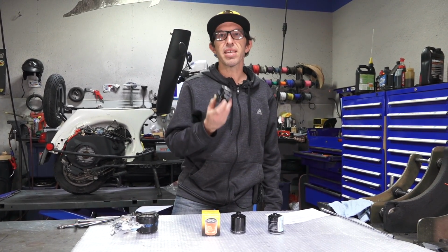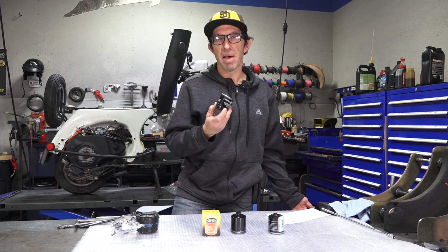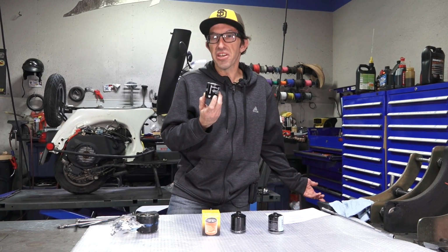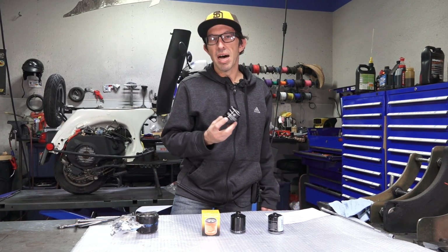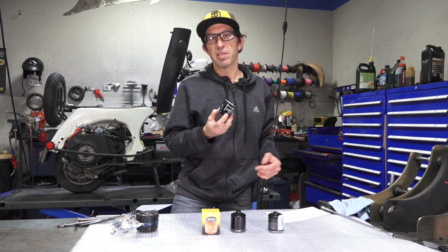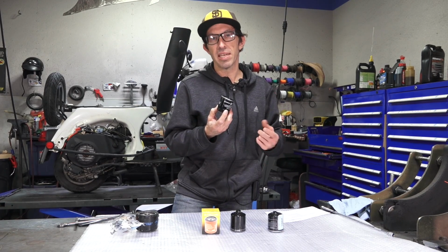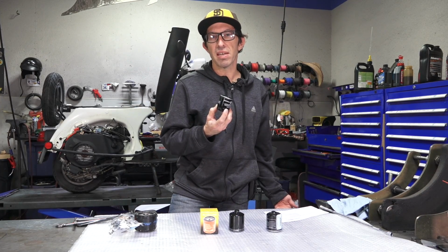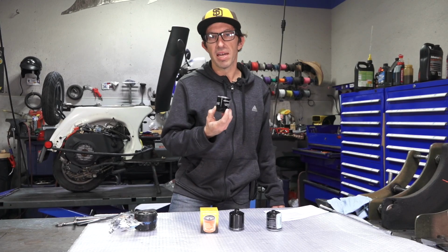So today I'm going to talk about the most mundane item on your modern automatic four-stroke Vespa: the oil filter. Everybody knows if it's got an internal combustion engine, you probably assume it's got an oil filter in it. Well, pretty much with the Vespa series, I'm speaking of the modern Vespas that are four-stroke engines, where you pour the oil into the crankcase and not into a separate oil tank. Anything that's 125cc and larger on both Vespa and Piaggio has an oil filter on it.